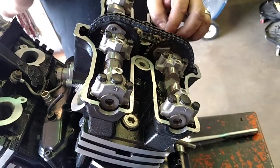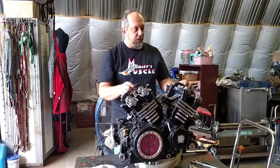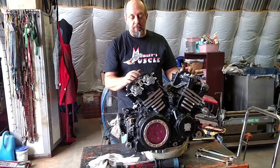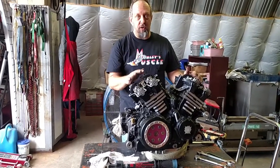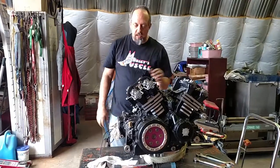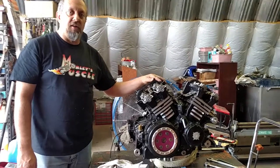Interestingly enough, if you don't get the rotation correct, these engines will actually still run. They'll run very poorly — you might think you have a carburetor problem. It'll backfire, it'll start and rev, you can ride it, it'll just seem like it's down on power. And what you'll need to do then is if you have messed with the camshafts, it's quite likely you've got the orientation off. So that's kind of the procedure we use. The OEM does it a little bit differently and you're welcome to use that method as well. Slotted sprockets, of course, hold different scenarios — you can retard or advance cams to move your power curve. I'm going to go ahead and get this finished together, double-check my cam timing, and also go through and double-check my valve lash while I've got the engine assembled. We did that initially when the heads were done, but it's always good to double-check that.